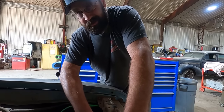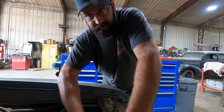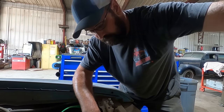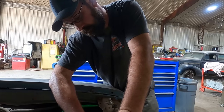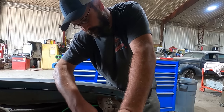Usually I think when you got a fresh transmission cooler and lines and torque converter and all that, it's like 3 gallons, 12 quarts. We got about 6 in there. And like I said, the torque converter should be full. We should have flushed the tranny cooler and the tranny lines out pretty good, so I don't really know.